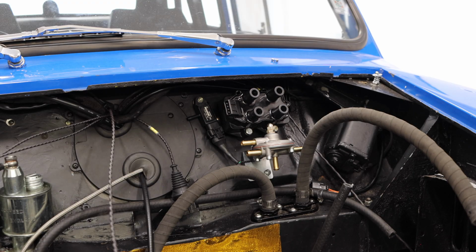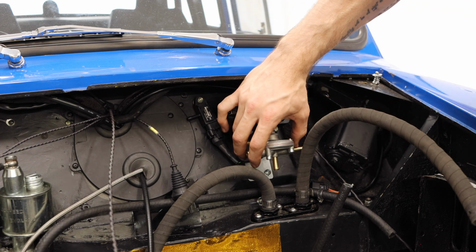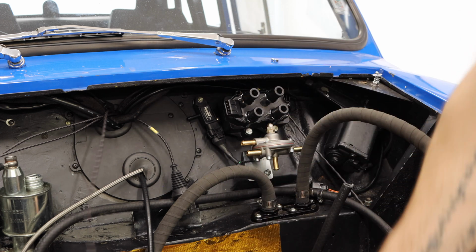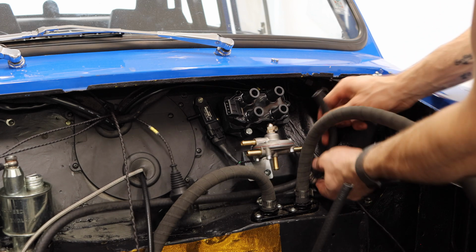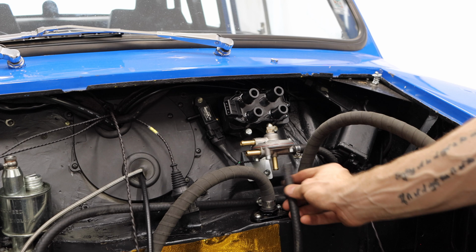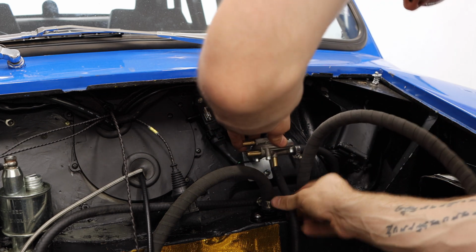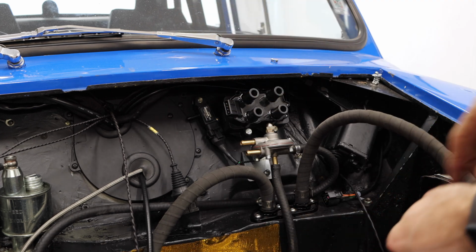Okay, so the last thing that I want to do today is actually get the fuel lines connected here, and then this 12-volt line connected to my fuse box, where that can live on an ignition-based wire. It doesn't need to be always on. So, fuel line's gonna come up here, something like this. This right here is our return. That goes back to our tank. That's the excess pressure coming back from our tank.